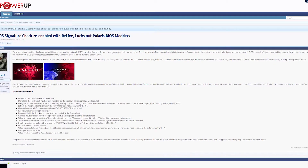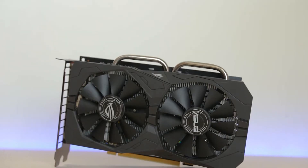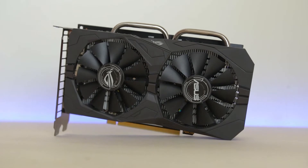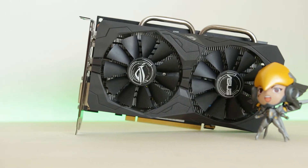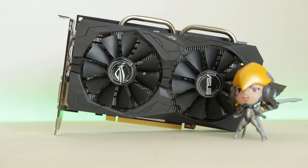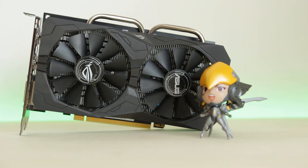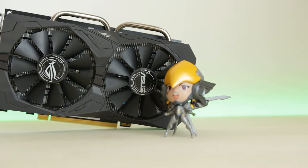Here on this page are exact step-by-step instructions for it to work, and for me it worked flawlessly. This process involves downloading a modified kernel driver, a patch file, booting Windows into a disabled driver signature enforcement mode, and a few extra steps. It actually wasn't that hard to do, especially if you've done this kind of thing before, and it worked perfectly for me. After the steps you should end up with driver number 16.12.1, which is way out of date. If everything was done correctly then inside AMD Radeon settings you should be able to download the latest driver just like you normally would — for me it was 17.5.1.